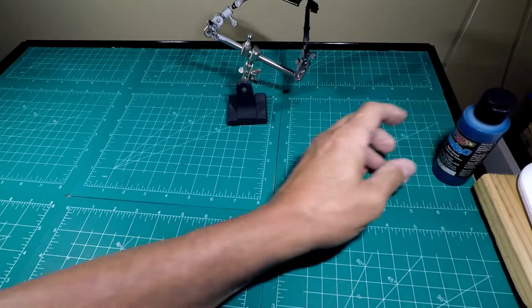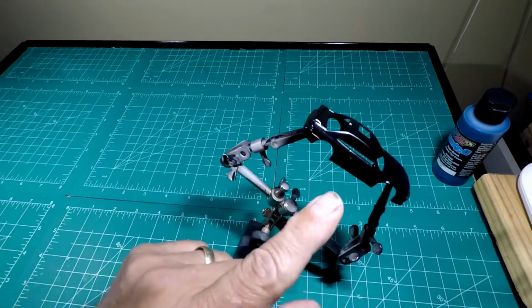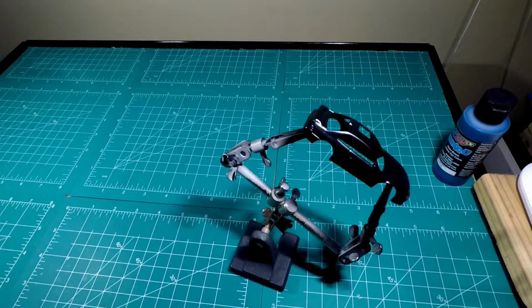For a candy color to shine through, it first has to have a silver base coat. So now you got to figure out, well, what silver base coat do you want? You've got the aluminum, you've got the metallized version, you've got what used to be Quicksilver Chrome, which they don't call Quicksilver Chrome anymore. I think it's just Quicksilver and the number is W357 or something like that.